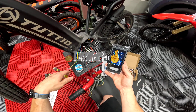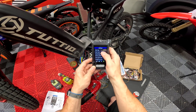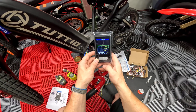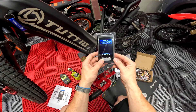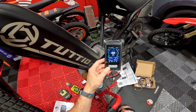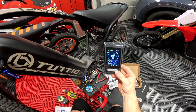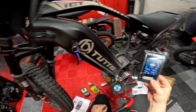Follow yellow to orange, green to purple, then find a 5 volt and ground and the screen will come on. This works for any bike that you put a VESC on. With this screen and any VESC controller, you go through the settings and pick your type — we have it on VESC FSESC. There's no documentation, I had to figure all that out just from pushing buttons. When we come back I'll have it mounted up, and then we will go for a ride and see the speed, duty, and battery.